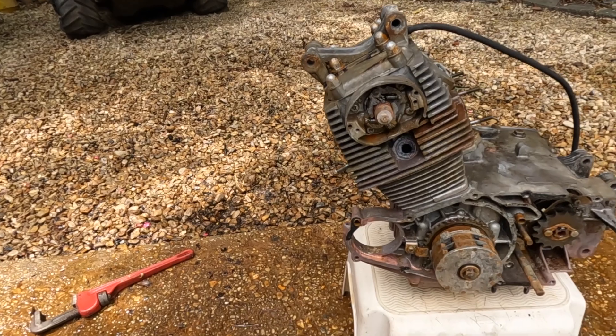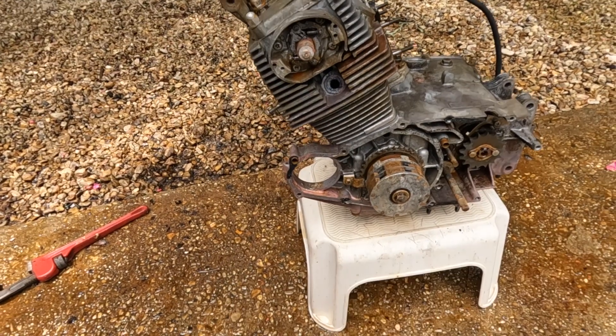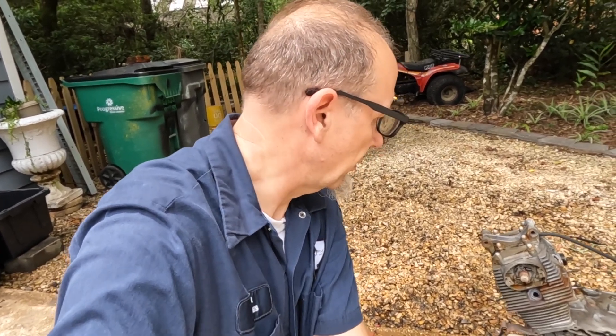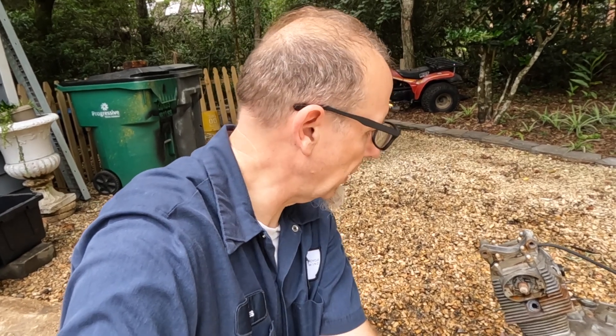Now that we have the clutch side cover off, we'll be able to get more flow through it. We may flip it upside down — our pistons are at the top of the cylinder. So I think what we're going to do is flip it upside down so that the juice runs down into it and the cylinders stay kind of underwater all the time, like we did with the top part. Maybe that'll help feed it through the case. We'll flip it around, get a couple more gallons of vinegar, and we'll see what happens. We'll check back in a week.